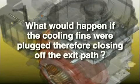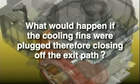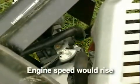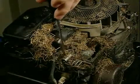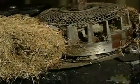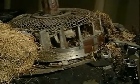Now, what would happen if the cooling fins were plugged, therefore closing off the exit path? Engine speed would rise. If air can't get out, it can't get in. If less air is allowed to enter, air pressure is again reduced against the air vane. The governor spring once more gains the advantage.